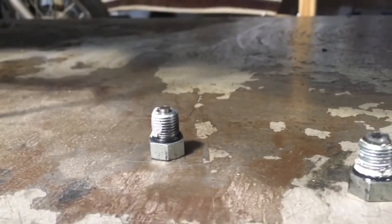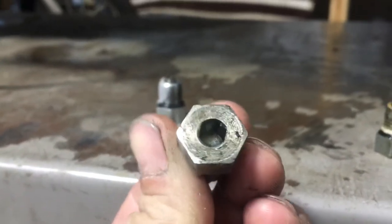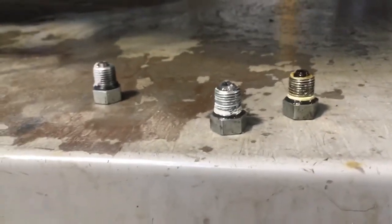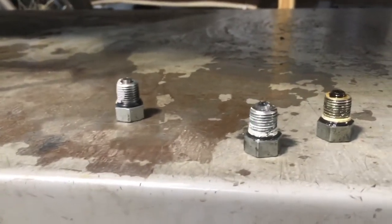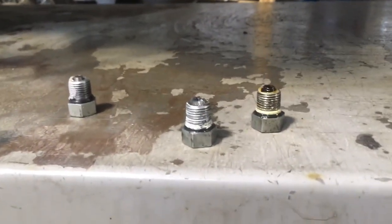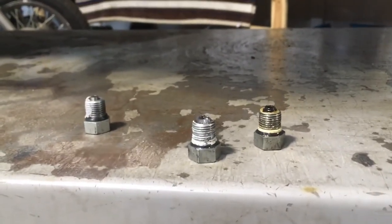So this is the right way to do it, guys. Also, something that some people maybe don't know — it's a 5/8 hex, and then the center will use a quarter-inch drive Allen, so you can use either or. You don't need to crank these things down and over-tighten them and squish those O-rings out or break them either. Good luck guys — I hope this helps somebody and makes it easier to do your services going forward, and hopefully stops the leaks too.